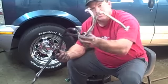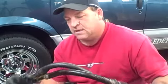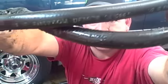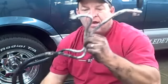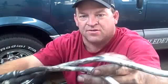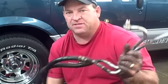Hopefully you learned something. Check us out at ScottiesMobileDetailing.com. The part costs about $75 — where they tend to leak is right here, on those gaskets, right where those clamps are. That's where they start to give way, and you can see how oily it is. It took about an hour to replace. They also rub right here — these two hoses kind of sit on top of each other, so they've been known to break there too. The hardest part I would say is getting the hose back into position. Removing it, it kind of falls out — you just got to fanagle it to get it out — but getting it back up into position is pretty much the hard part.